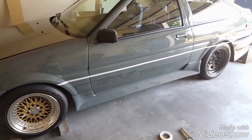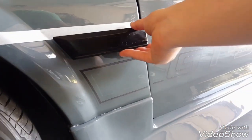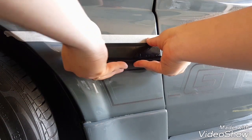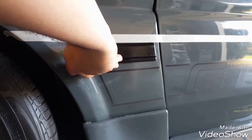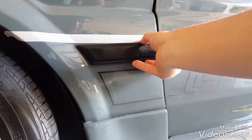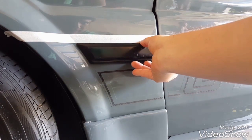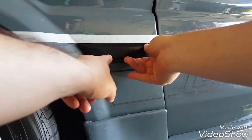Here we've got the car, the line's ready to go. Here's another way to tell where your molding is going to go — you see how it fits perfectly with this fender line right here. You want to leave a little bit of space on the door there — you don't want it right on the edge. You want a little bit of room. If it was up higher it would look weird and there would be too much space on either side. This is the perfect spot right here. And if it's too low, then it's too tight a fit between the door opening and the front fender.